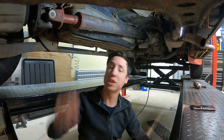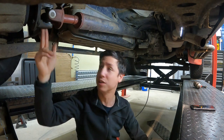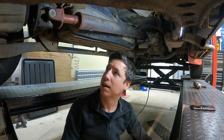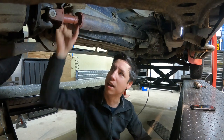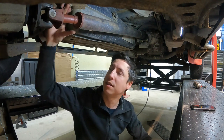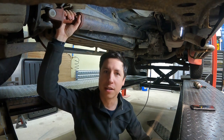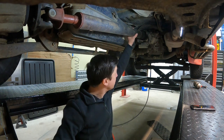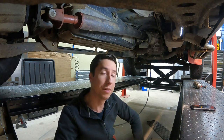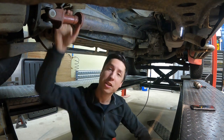So we're under the van and we're just going to check the u-joints on the driveshaft. We've got our rear u-joint here and our front one. I know that my buddy has actually already changed this rear u-joint — it's brand new. But I did notice there's a little bit of play in it still, and it's not a rotational play, it's actually side to side. That tells me that our yoke has actually started to split apart a little bit, so we might have to deal with that — that could in itself be the vibration. But it's pretty minimal. The front looks pretty tight, no play there. And we do have a little bit of wear in the transmission bushings, but that really shouldn't be causing our issue. So we're going to hop out and get the wheels off.